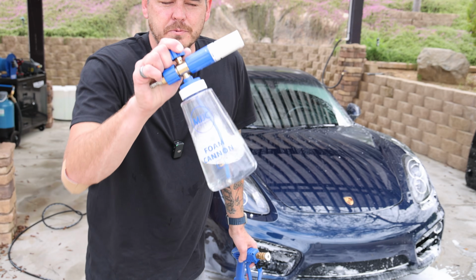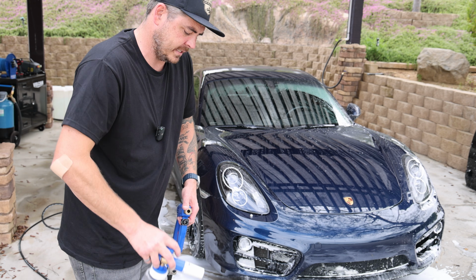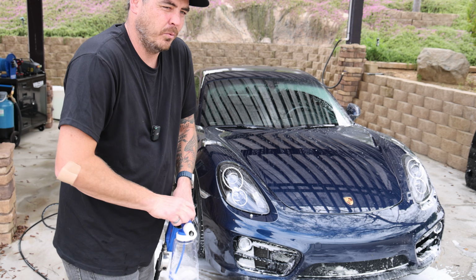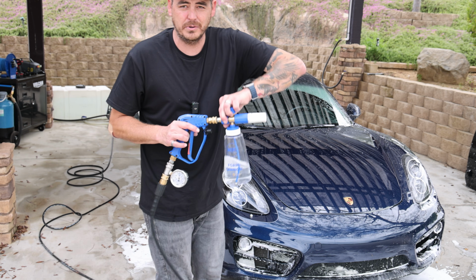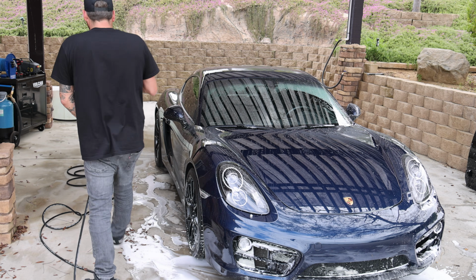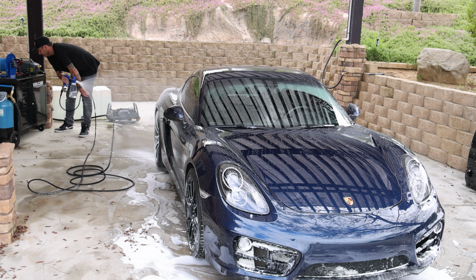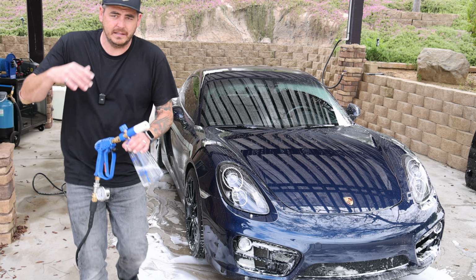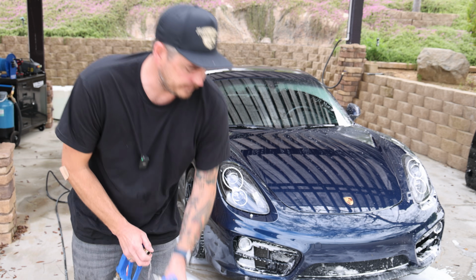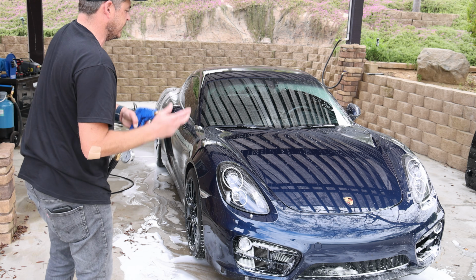Now, if I remember well, this one actually has a 1.25 orifice in it. So let me go ahead and check the amperage with this, because again, I think they talk about a 1.5, which would definitely spike this above the 15 amps. So let's see. Yeah, we're at 18, we're spiking like 18.3 amps. So let me see if within the box of the Aactive, there is a little orifice. I don't know if it was for a foam cannon. Let me go check that really quickly.